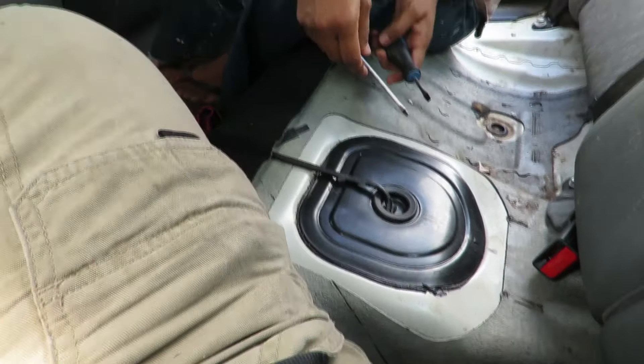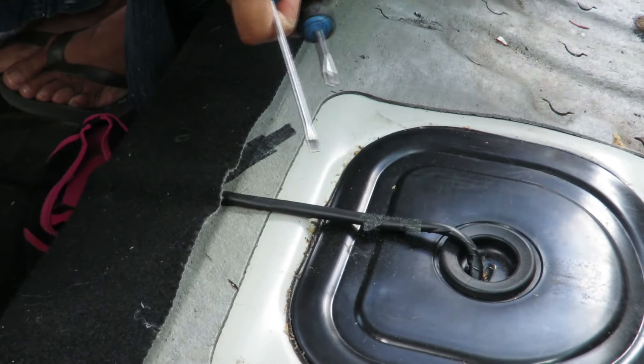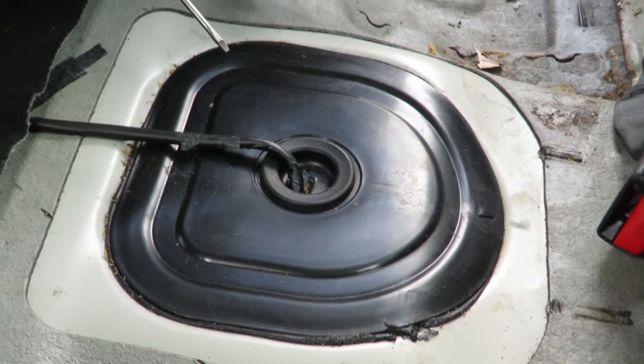After you get the screws out of the back, grab the front part of the seat firmly and raise — it will pop up just like that. After you get the seat out, you have to remove the outer cover where your cables and cords run to your fuel pump up under the back seat.